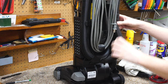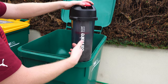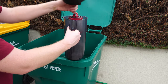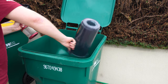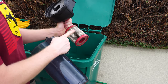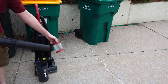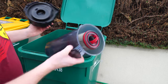There's no full-bin indication on this machine, but typically when it gets about half full is when you want to empty it. To empty, you undo the dust cup and pull the filter out — which has all sorts of nasty stuff in it — and it's a top-empty design. You can see the dust going everywhere; you would never do this inside. You're supposed to clean the inner filter, but unless you have another vacuum or compressed air, it's a real hassle.